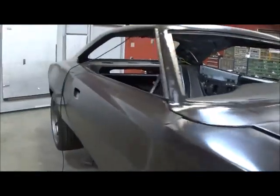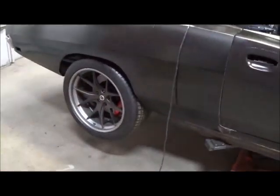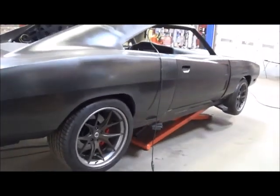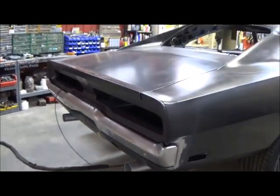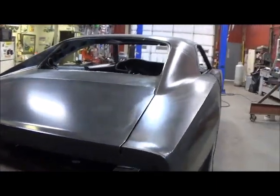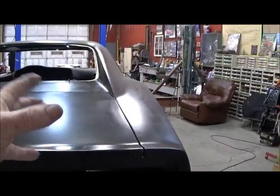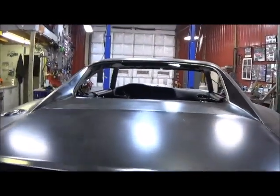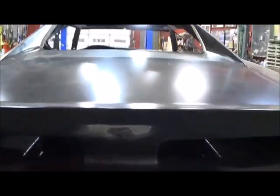But in most of the back, I got my 12-inch wide wheels fit, and I took all the suspension out of that and articulated it completely up and down so that it goes all the way to full extension and full compression without touching the body. Got my bumper pretty much fit in place. These quarter panels, it really looks wider. I don't know if it shows up in the camera, but leaning those in looks nice. So I could flush fit that back window. My backup camera's in place.